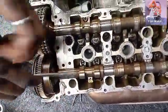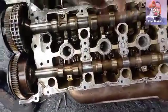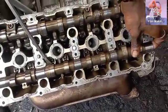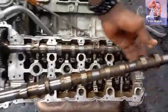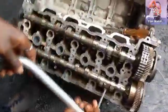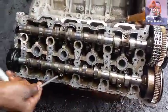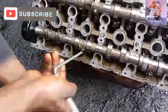I'm done with the two bolts. Next thing is I'll get my screwdriver and it will help me to bring it out. As you can see, the first one is out. This one is easy to remove because there is no chain holding onto the camshaft. So we'll go to the other side — the right side — and do the same thing.